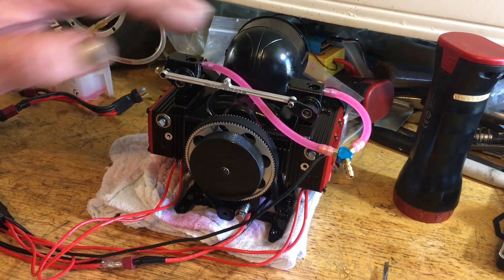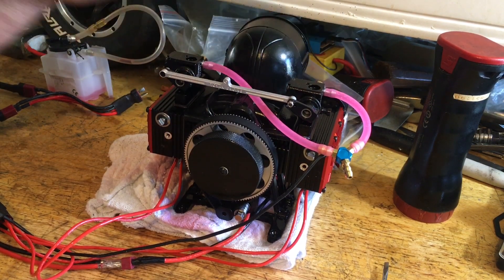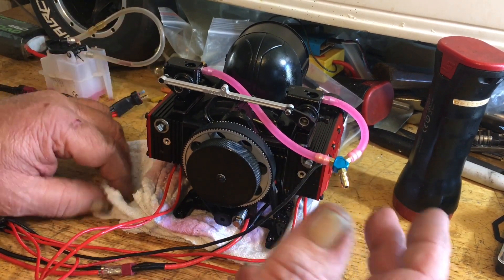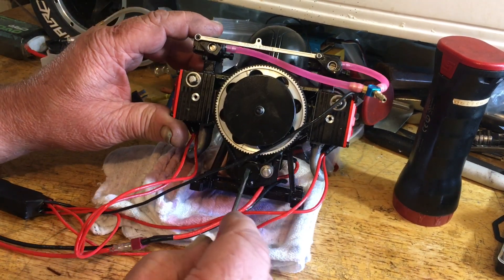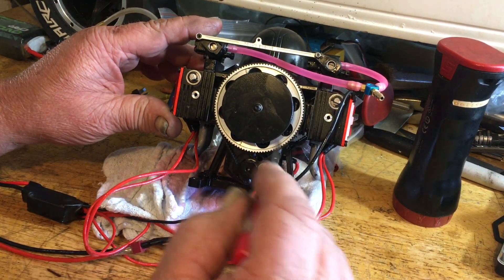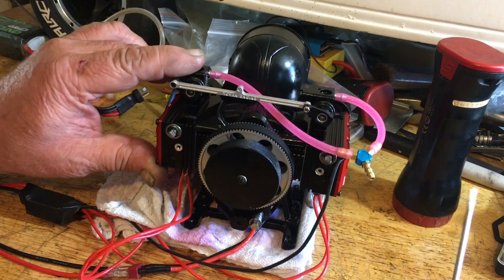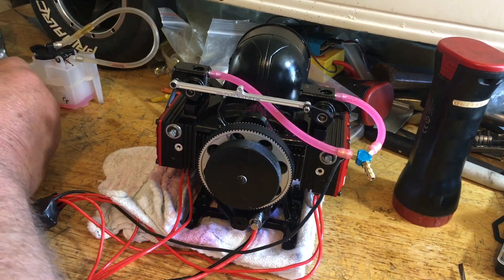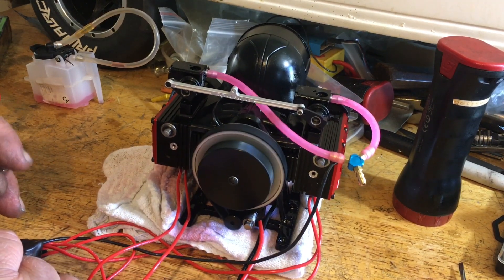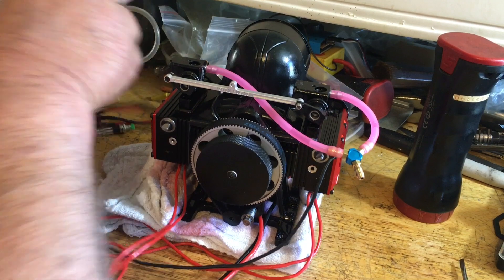I got it running now, but it's huffing pure raw fuel and exhaust smoke out of the carburetor, which tells me one of the valves is not sealed. As far as the tensioner on the camshaft belt and the starter belt - this is great, it's so quiet, it doesn't strain the engine whatsoever. It just turns right over nice and quiet and the motor doesn't really heat up.